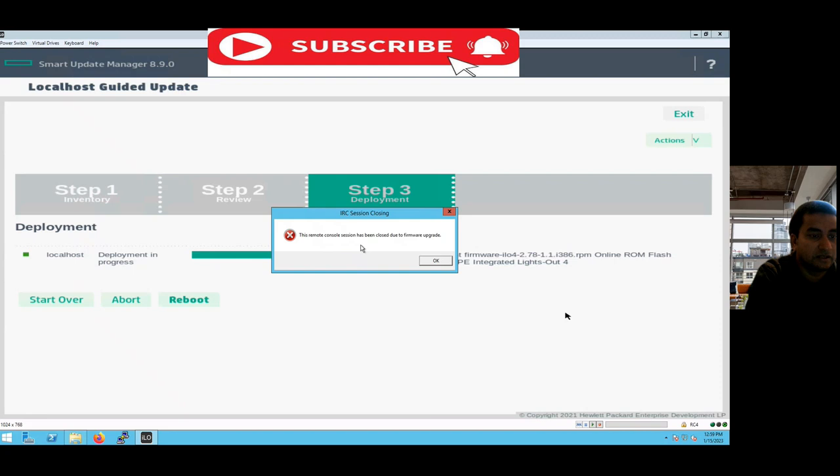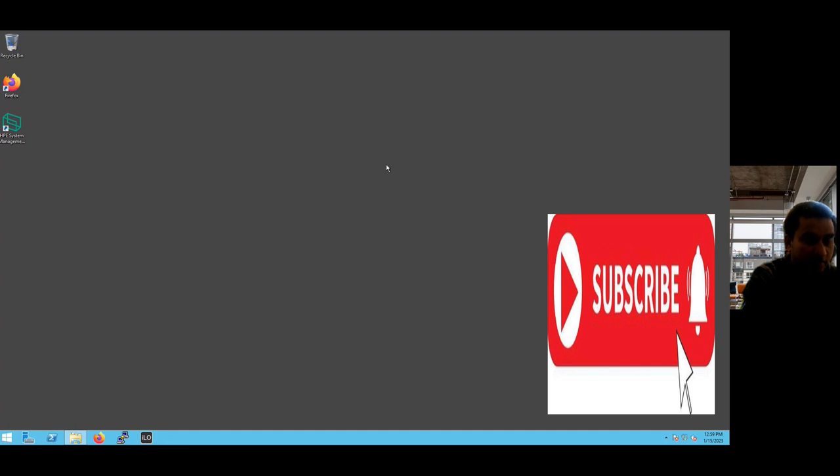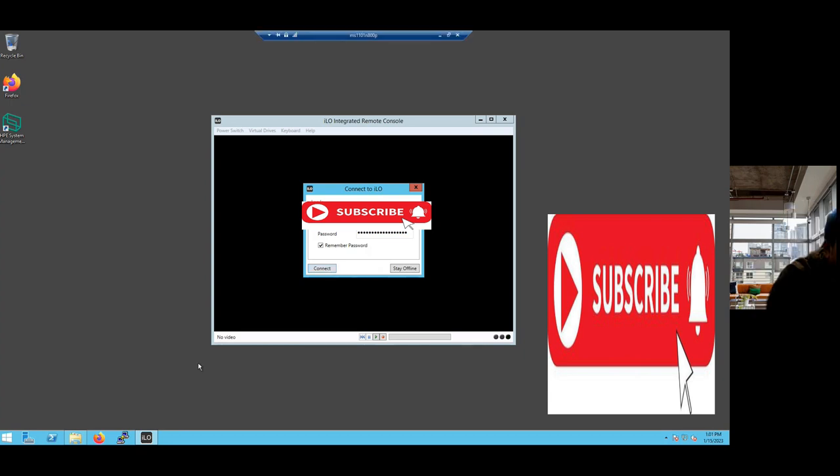OK, see here. IRC session closing. The remote console session has been closed due to the firmware upgrade. So I am disconnected from the ILO. Click OK. Now it's closed, right? If you open it again and click connect, you will not be able to connect, because you have to wait at least 4 or 5 minutes. So I'm going to wait. I'm not clicking here right now. I'll do it after 5 minutes. What should be the next step?